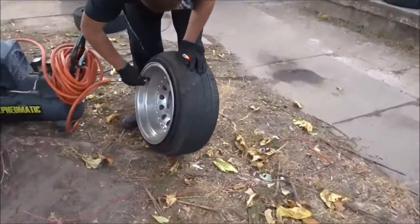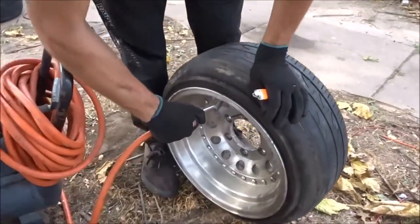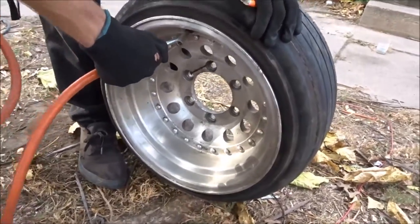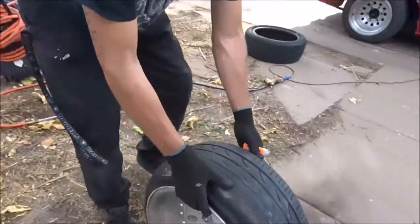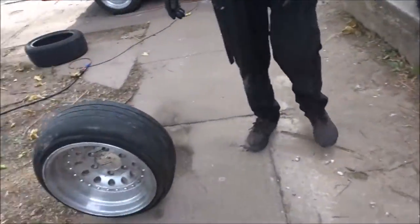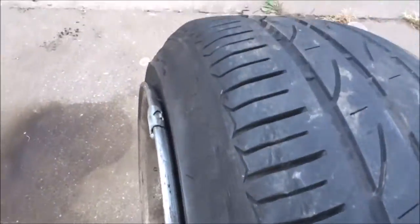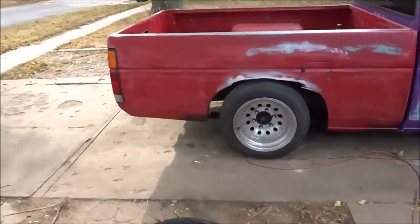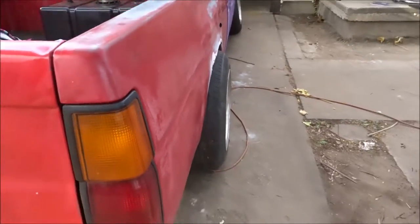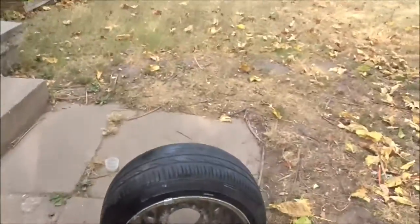Sorry for the wind noise. These look pretty good with those stretch tires. I told you they hold air — let me see that water bottle. Fill it up and then just spray water around the beads on both sides, and if you see any air bubbles then you'll know it's leaking. You guys can tell the back won't have any camber, and he's barely going to drive it until it gets fixed up. You'll be able to tell the different size tires for sure.